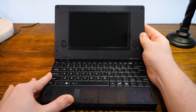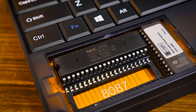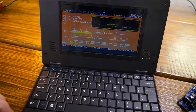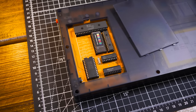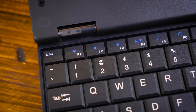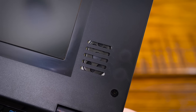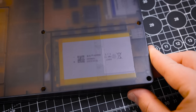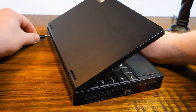Let's start with the Book 8088 — effectively a Turbo XT PC in a clamshell case. So inside it's running an NEC V20, clocked at either 4.77 or 8MHz, swapping between speeds by pressing Function plus F6. It also boasts the always-enough 640K system RAM, along with 32KB CGA graphics, PC speaker output, and an AdLib-compatible soundcard. Although there is no volume control despite these function keys — the only thing these do is mute, eliminating all sound from both the top panel speakers and headphone output on the side. The system runs on a 4000mAh lithium-ion battery installed inside, but that only lasts a couple hours, so the 12V AC adapter is recommended.